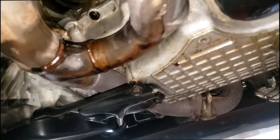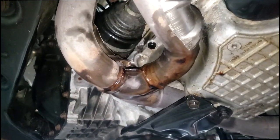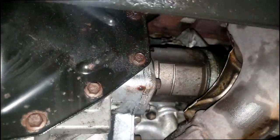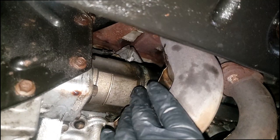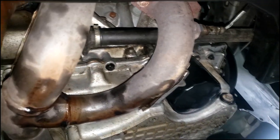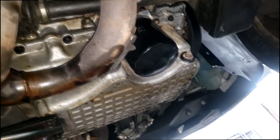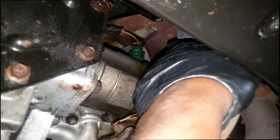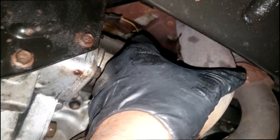It's getting worse. I had cleaned this off with brake cleaner and told them we need to steam clean it and drive it, but yeah, there's really no need to drive it — it's leaking pretty bad. Where are they hiding it? They got it shielded off with an aluminum piece of shield covering it, so I just got to remove the shield and use my socket to unscrew it. The connector has already been manipulated — simply removing the little pin. In some cases I don't even put the straw in; I just remove the pin so it can vent. If this was weatherproof and sealed, your light likely will be flickering and you likely will have oil migrating up to your PCM. So it's a good thing this connector is venting — it's a good thing I pulled that pin out.